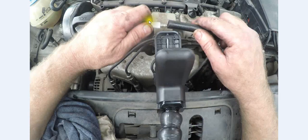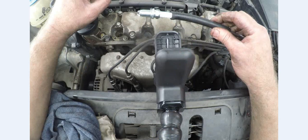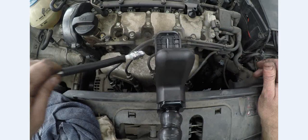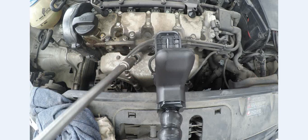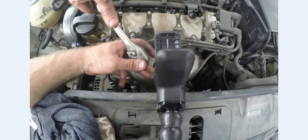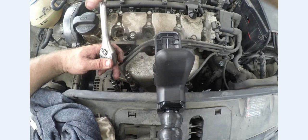So we go on to my trusty little tool. You just take the back of the spark plug, push it into that rubber — the rubber is pretty flexible so you can go ahead and put the spark plug in and get a nice thread on it. Turn it nicely; the thread must go nice and smooth, it mustn't be tight, it must turn nicely by hand. Give it two, three turns. Pop the tool off and then pop on the socket and ratchet. I use this long extension which gives me better reach and then I've got a crank handle on it just to go quickly — that's just to turn the spark plug in.